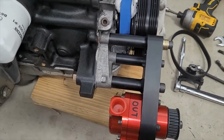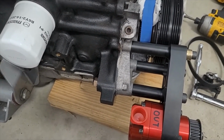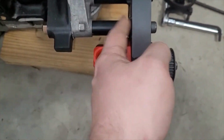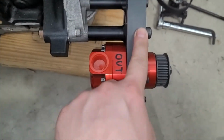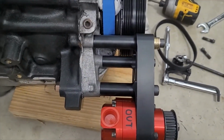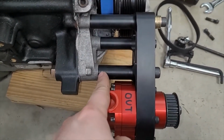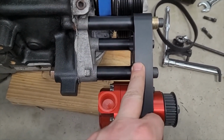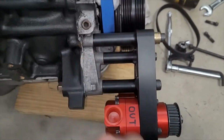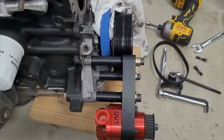Now, admittedly, that's going to be a giant pain in the butt to figure out how to do. I'm just thinking this through, I'm probably going to have to clamp this flat on something where I can get a line set up and set my axis system off of that. I don't know. Got to think about that. But I think we can save it if we do that, because I could say, for example, I don't know the number, but let's just say this is 1/2 inch or 1/4 inch or whatever. Once it's set up, I can just skim that distance off of all three of these, and they'll still be the same proportions. So we should be able to save it.